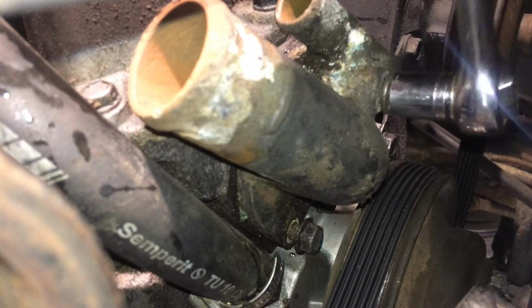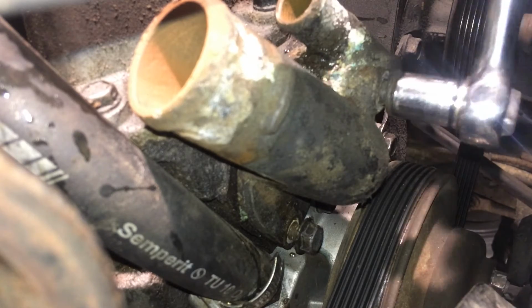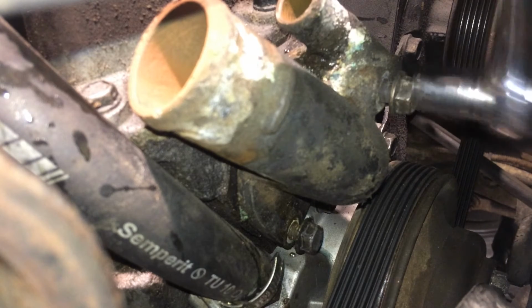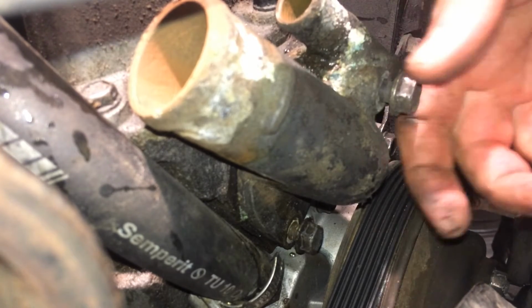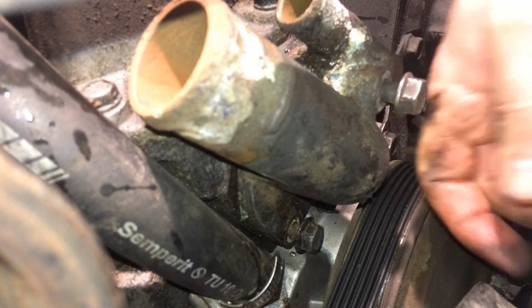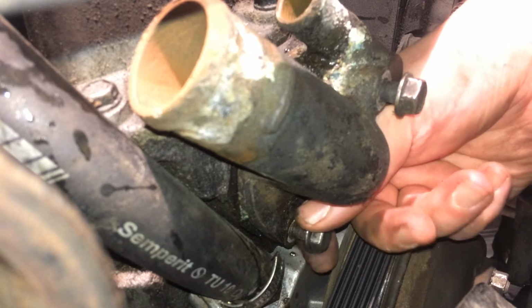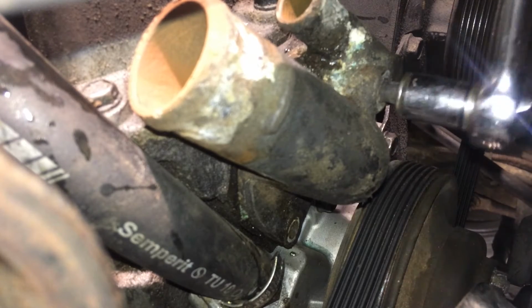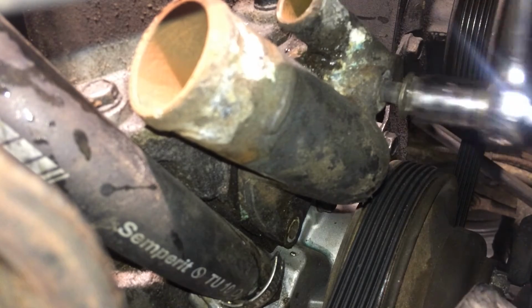It's a bit worrying when you do mechanic work yourself after you had it left in a shop, and you find out that all the bolts are tightened at maximum or even higher torque values than they're supposed to be according to the instruction manual, and at the same time you find that all the threads are full of silicone. You should always remember that when you use a sealant or silicone, you shouldn't torque the bolts to their full torque values. You should go about 25% lower to avoid too much pressure on your threads, otherwise you might blow the threads in the block, and then you're stuck with a recoil or putting in a new thread into your block.